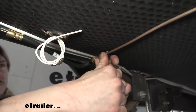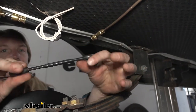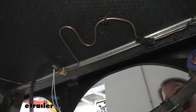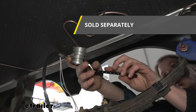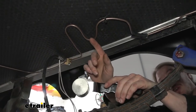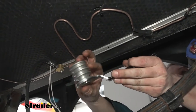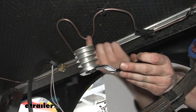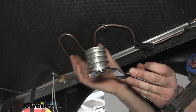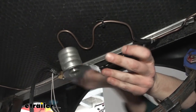Same at the actuator — when tightening the hose where it goes into the actuator, there's a nut coming out of the back of the actuator, so make sure you put a wrench on there as well when snugging everything down. Another tool I highly recommend for this job is a brake line bending tool. This ensures you can get aggressive bends on your brake line without kinking the lines, so fluid can easily transfer through more aggressive bends. The line goes in and wraps around the tool to prevent kinking — without it, a hard turn like this would have definitely kinked the line.